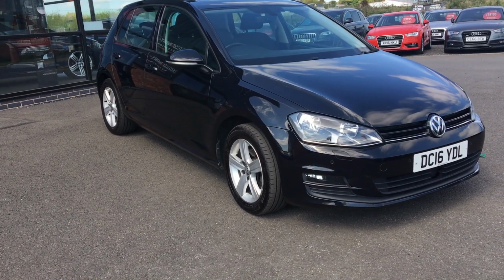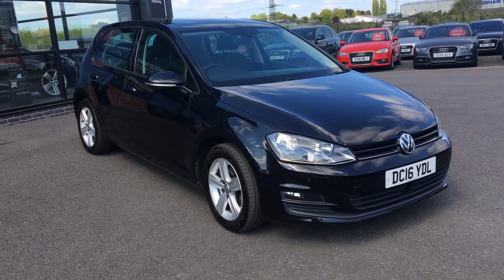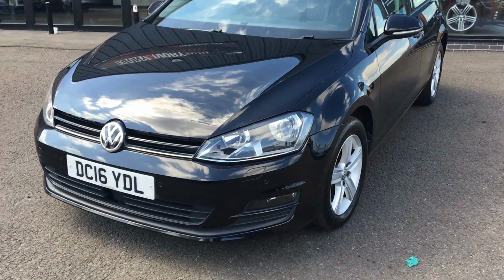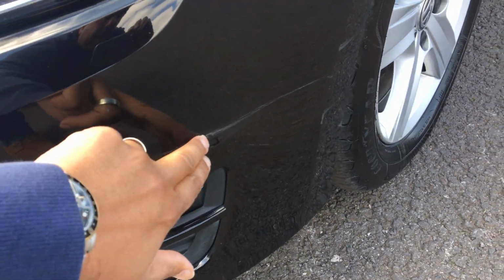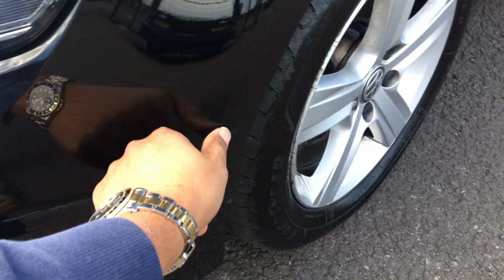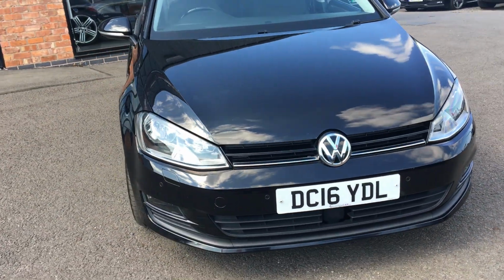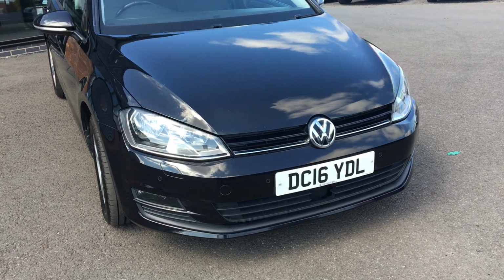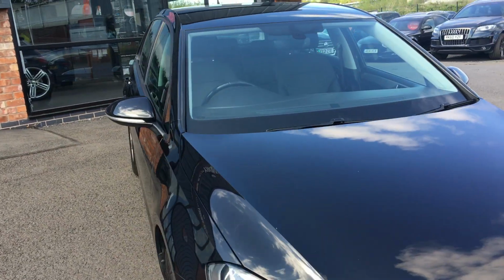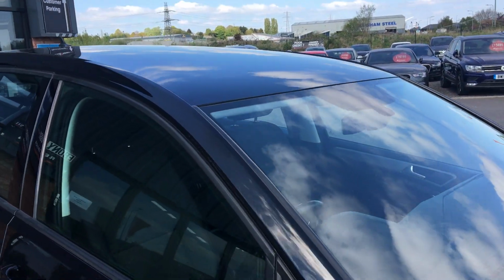Do the same up and down the vehicle, this time going from front to rear, different angle, just to see if I missed anything. Can't see anything up and down the panel work of the vehicle. Dent guy to check, as he will be doing the offside rear quarter. No nasty scuffs. Slight scuff to the paintwork of the offside front corner. So could be flat it, polish it, or may need a bumper corner in the paint shop just to mint the vehicle up. No damage to the grills or the lights or the trims. A couple of stone chips on the bonnet to touch in, but nothing excessive. Front windscreen looks to be in good order as well. Maybe the odd light chip mark on it, just given the fact it's a used one.